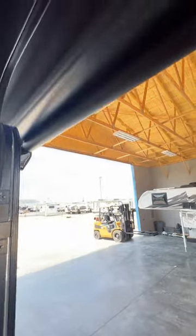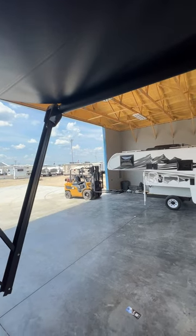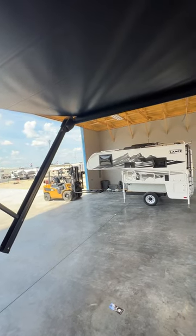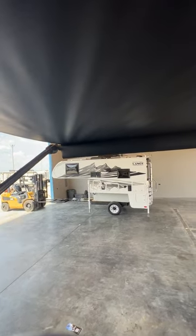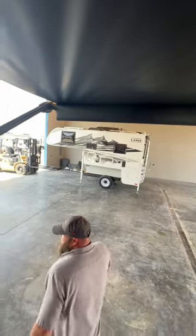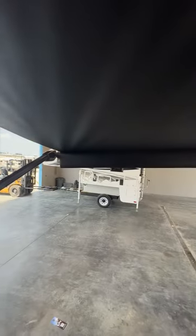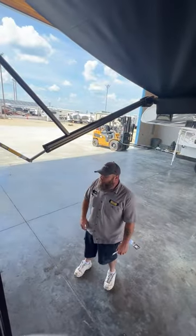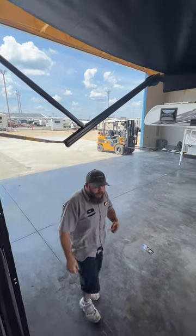Then we have our awning to bring it in and out. We'll go ahead and bring that guy out. Basically, what we're looking for is that flap to be vertical with the ground. Your awning does have a pitch adjustment — you can just take this guy here, pull it down, and it will create a pitch. This is meant to be as a shade protectant, but do always recommend that if there is a storm or if you're going to be leaving your camper unoccupied, you should be bringing your awning in — too strong of winds can damage both your awning and the camper.